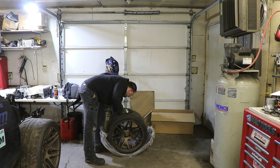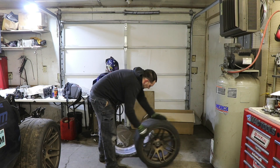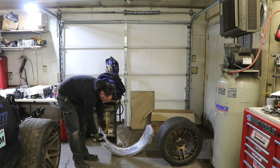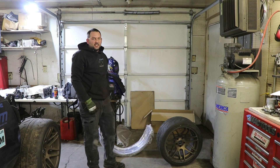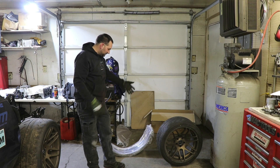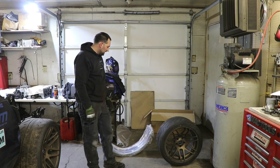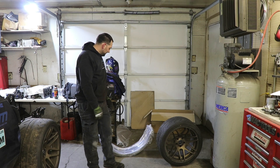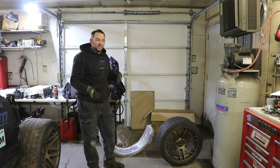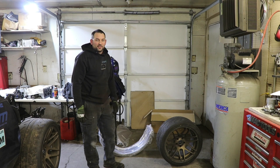I got fenders with side plates so I can seal it all back into the trunk area. Since I only need to go down 10 inches and these are 15 inches tall on the side, I'll cut some off the top. It's all 16 gauge, which should be at least a little bit thicker than what the trunk is already, and putting that extra dimension into the trunk floor should help strengthen that area. The nice part is having the full size spare and maybe space for the jack - much nicer for when I'm traveling on the road without the trailer.